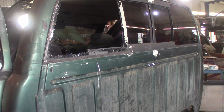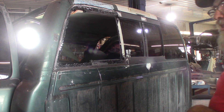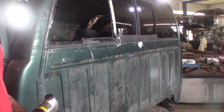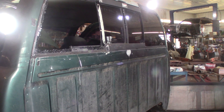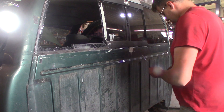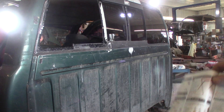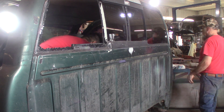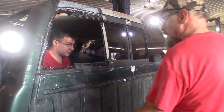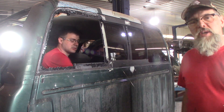We're going to try to saw this out. I used the oscillator — one $20 blade and I got about three feet done. The Onyx by Astro. He got about two feet with it and it broke. There's a really sharp angle on the inside there to try and cut it out, and they do have different blades. Here's the blades from Auto Body Tool Mart — they got a different configuration. Maybe this one would have worked for us. That thing just oscillates, it's almost like a Sonic Crafter tool — a real fine oscillation. So we're going to give this wire a try. I just don't want to burn another $20 blade. Look how easy that went — well, it's because I already cut half of it. It wasn't so easy — I have to reposition the camera.